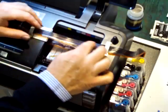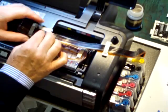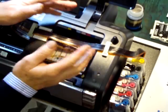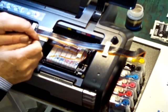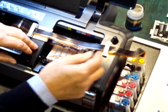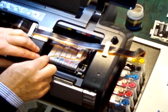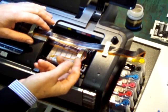Make sure all of your tubing lengths are fine, allowing the carriage to go forward and back without being too tight. Continuous ink systems are very simple - either your ink is not coming up the line, in which case you can just syringe it through, make sure you've got enough ink, your breathers are clear. If you've got a free flow of ink coming up the tube, it has to be the cartridge, so all we need to do is clean up the cartridge, and if that doesn't work, simply replace it.